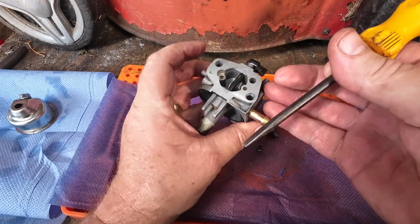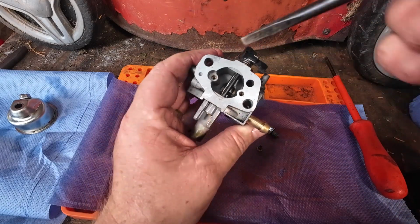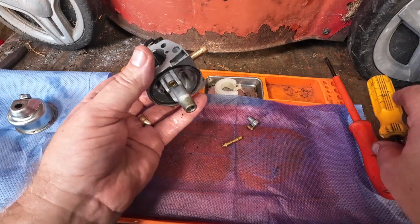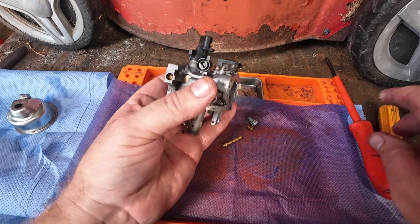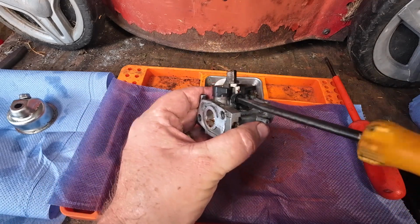Emulsion tube to come out. It's a bit sticky. It's right inside there. Let's see, right inside, little tiny brass bit poking up. There it is there. Screwdriver in, push that down, give it a tap, and your emulsion tube will then come out. Right, that's nice and easy. Over here also, we've got another screw to remove. And just unscrew that one.